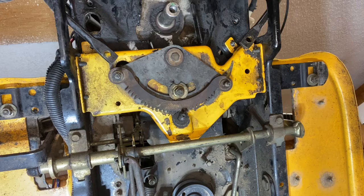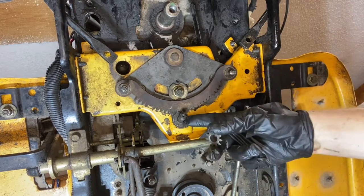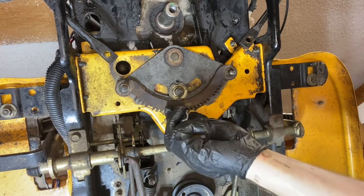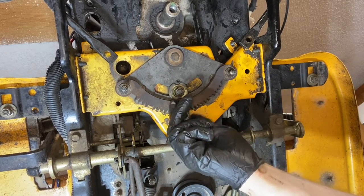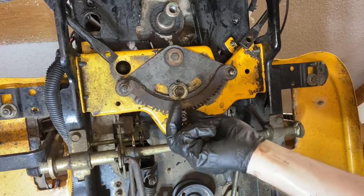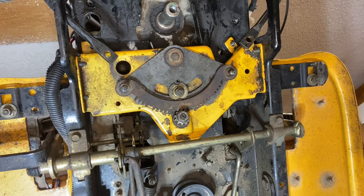Look at that — ain't that pretty? We got it all cinched up and good to go. We've got the six bolts in there. Next, we need to put the pinion gear — all these little kits come with a new pinion gear. It just slides on right over that shaft, then you get your pinion gear nut, just like you took off, and cinch that up. You want that sucker to be tight. If you don't have an impact, just have somebody hang on to that steering wheel.